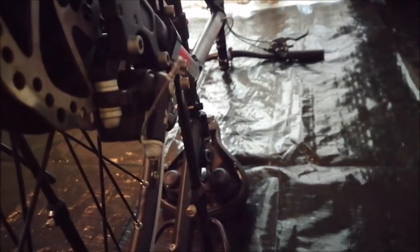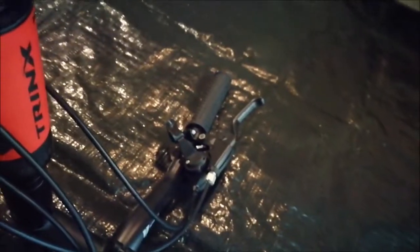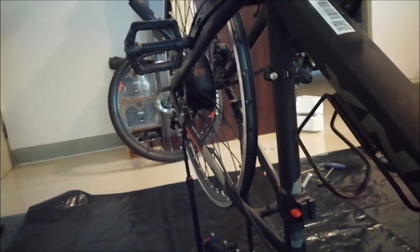And now a little trick. I loosen the adjustment screws. So now, if I press the brake, it centers to the disc, and then you just tighten the screws. Normally it would be good if someone would pull the lever to be sure that it is exactly in the center, but only one person can't reach the lever. That should be good enough for the start.